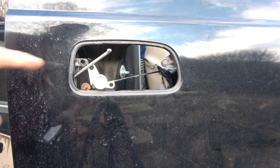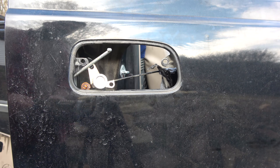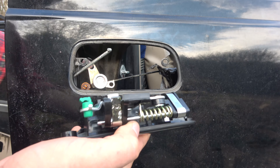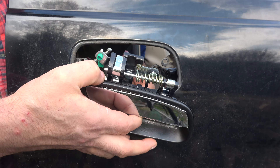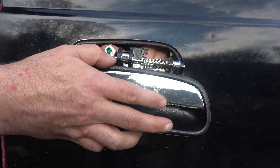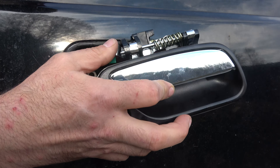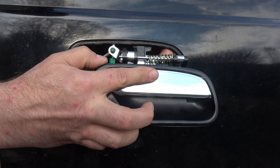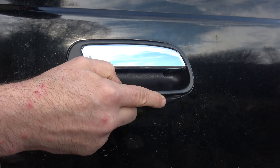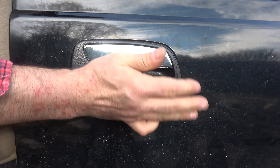I've lubricated everything up. Here's a better view — here's my replacement door handle, very much the same except this one has chrome on it, but I didn't really care about that. To reattach it, the lock has to go in first. We have our mechanical lever activator here — you can go ahead and snap that in. I'm going to snap that in there like so, and then that piece snaps back into place, and then we'll roll that back in — and there it is back in place.